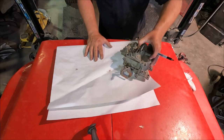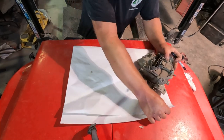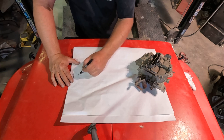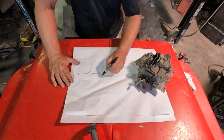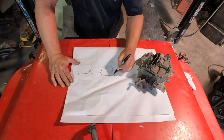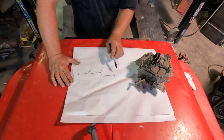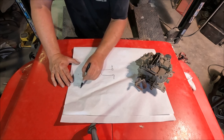Okay, now I'm going to explain to you why I cut up my brake wires. Now let me use my fancy surface here. Get the spider webs off it. And what I had, from the previous video when I installed the brakes, was a circuit that went to each rear light. They went to ground, and we just went positive through the brake light switch and split off to both lights, which works fine for brake lights. But now what I did was add a switch with two positions